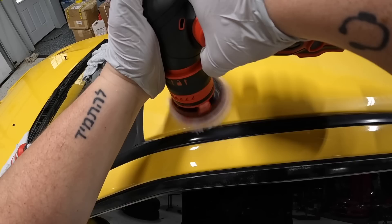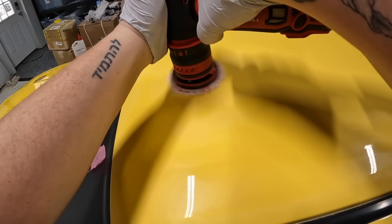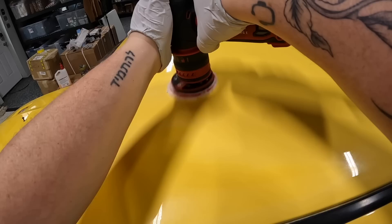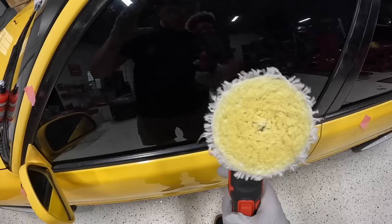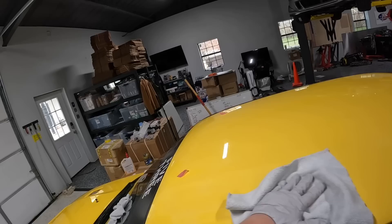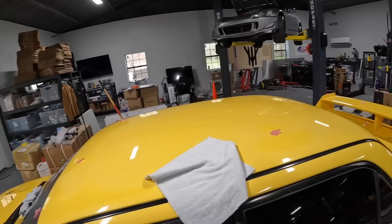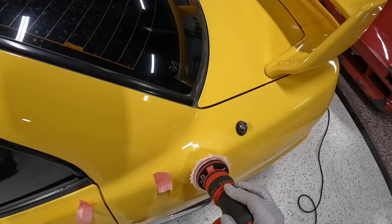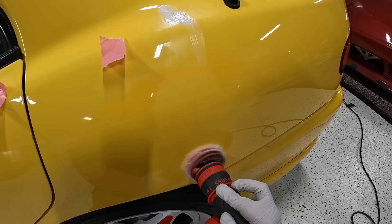Okay, here we go. That's amazing — I can hear myself think right now. It's definitely filing down some of that clear coat. This is a really big testament to what it can do; really what I should be using is a high-throw super aggressive pad. You can already see that I've smoothed it out a lot more — and it's not too warm either. You can see I'm under the clear coat so I've got to be super careful, but it's working. Wipe off the product and you have a nice smooth finish. The roof needs to be resprayed anyway — I've thought about wrapping it black.